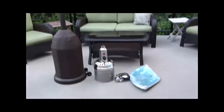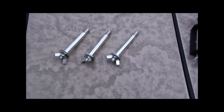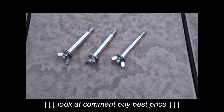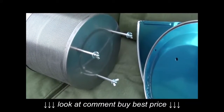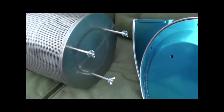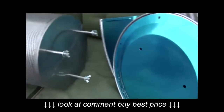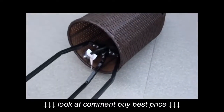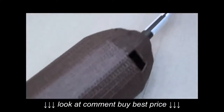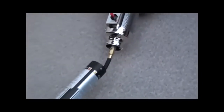Now I'm looking at doing the heater, getting the gas line hooked up, and then also the top part, the reflector. Here are some funny-looking bolts — they're actually reflector pins, and I'll show you where those go right now. The three reflector pins go on the top of the burner, and then they mount to the reflector to keep the reflector off of the burner. So far the trickiest part was running the hose up from the bottom all the way up that post, which was a bit tricky in the middle. And then I just had to connect it right into the burner.